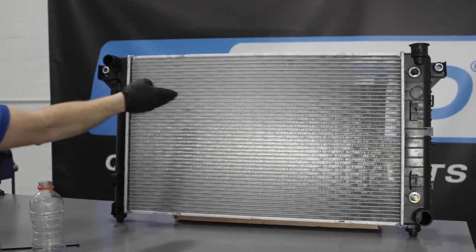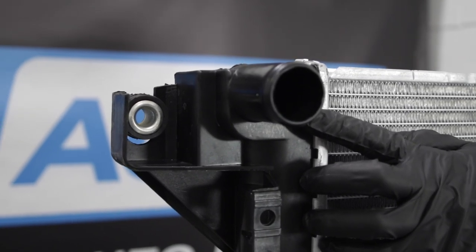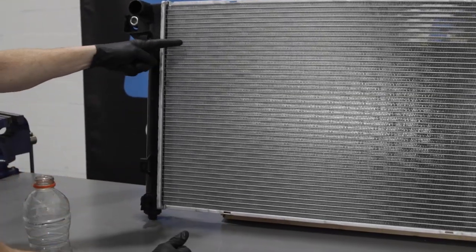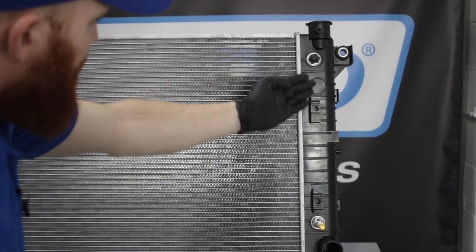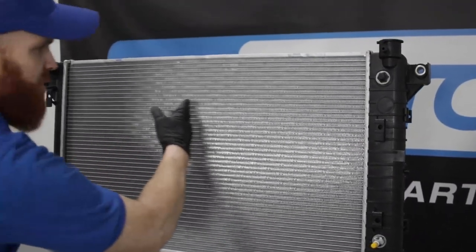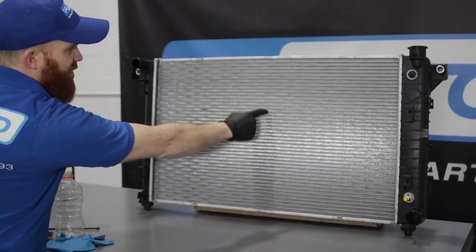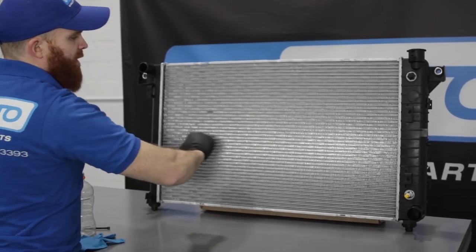So now let's talk about how it works. You come right over to the radiator — this is where your upper hose goes on, coming from the engine and thermostat area. It's going to fill up this tank and all these channels running parallel. It makes its way over to the other tank, fills that up as well, and then cycles out through the lower hose and leads back up to your engine. So it needs to be able to flow through this radiator, and as it's flowing, all these fins are cooling the air that gets sucked through or pushed through the radiator.